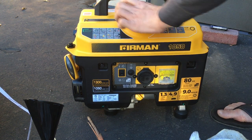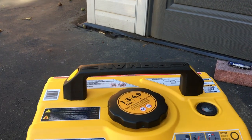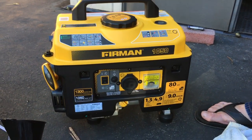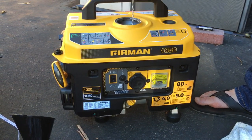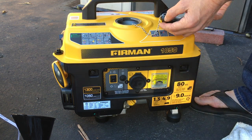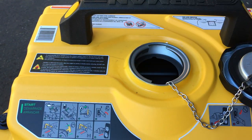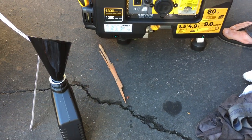I need to pour in gas — this thing uses 1.3 gallons. Oh, it says on top of the cap: no E15, no E85. So I guess it's okay with E10, but E15 is too much ethanol. Everyone with motorcycles knows ethanol in gas sucks. The cap has a little O-ring and it's actually wet — smells like oil to me. So there's a little filter inside the fuel tank — a little funnel filter — and that's it.